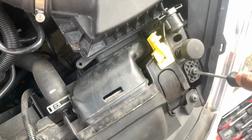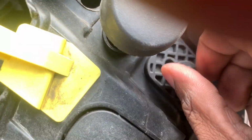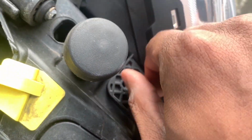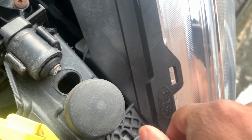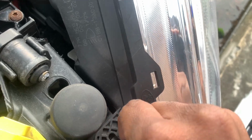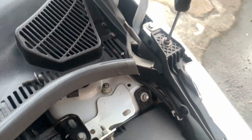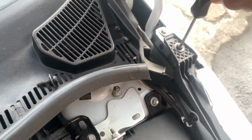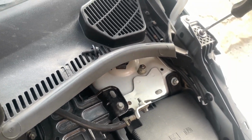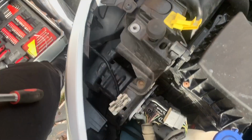So in this clip right here, I am unscrewing the passenger side headlight, or offside headlight, whatever you call it. I use a flathead because my flathead was big enough to fit into the Torx screws, but I do believe these are T30, and it's literally just 2 screws and a plug-in sensor, so one at the bottom and one at the top, and you should be good. Then you just plop it out, you put it off to the side. It's going to come in handy in the future when you're putting on your new intake, so I do recommend it.